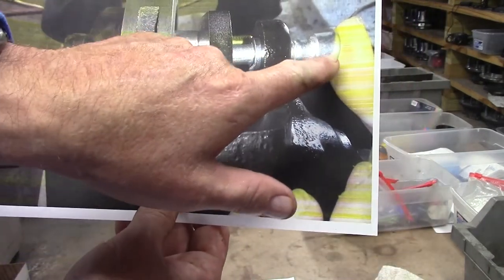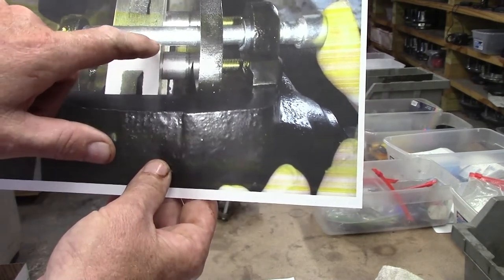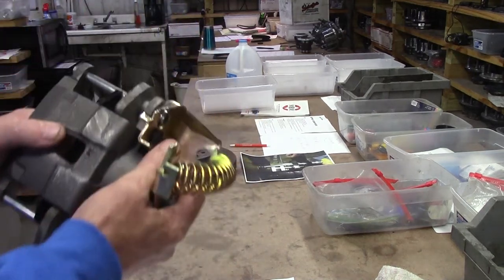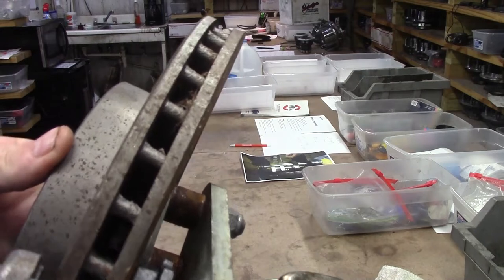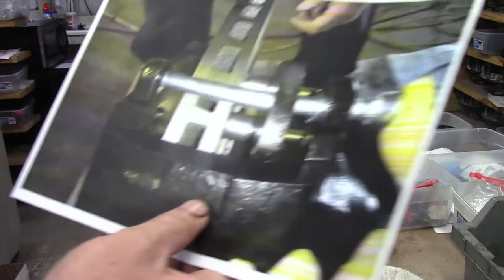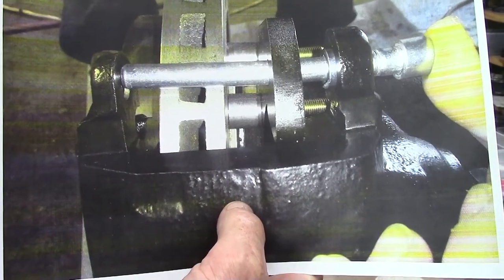His chief complaint is that the pin comes through the bracket and then it needs to slide out the outside, but it can't line up. The reason it can't line up is because the rotor is in the way — the rotor diameter is a little bit big, so the pin is cocked. The rotor is the only thing that can be holding the pin in the way. That picture tells me he's got the rotor with the bigger diameter of the two. With the slightly smaller diameter rotor, of course the pin will go right in — it's hitting.